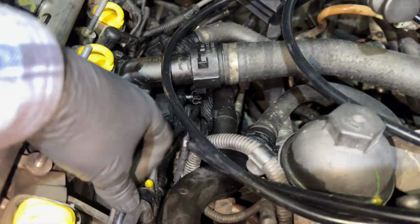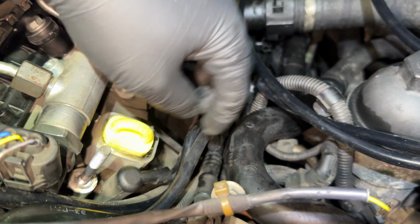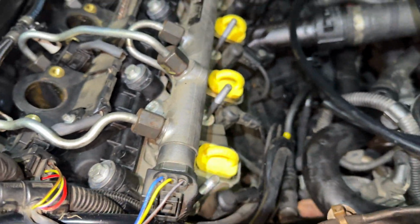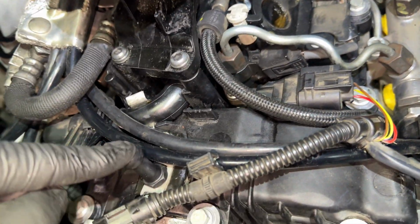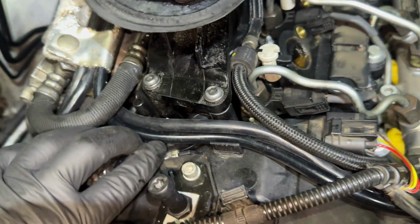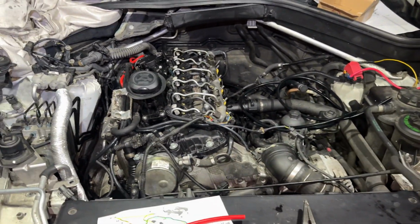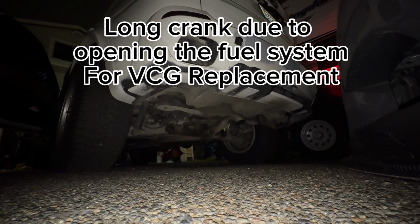These are run. To make sure that when you put your intake manifold back on, you don't pinch the vacuum lines under the manifold. Right here as well. And then when you put the air box cover on, make sure not to pinch it on these mounts either. So it's pretty close here, so you might have to move them over a little bit. And there you go. It will show you once I get this put back together as well.